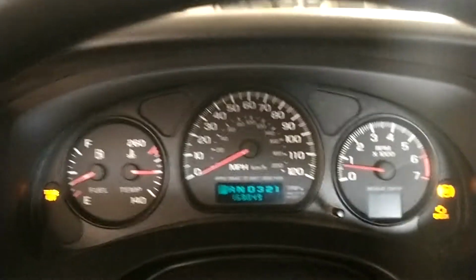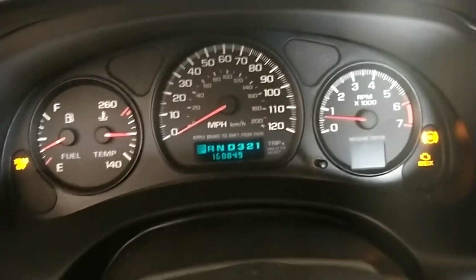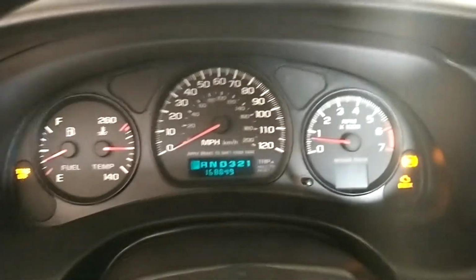The left front wheel bearing is shot. I checked the right front wheel bearing. They both have 168,000 miles on them. I figured both of them, you replace them like headlights, in pairs. So I jacked the car up, and I'll show you in the next video how to check the wheel bearings. But I checked the wheel bearings to confirm that these lights were telling me what's wrong.